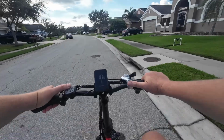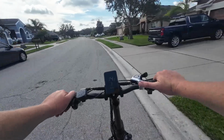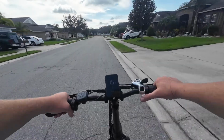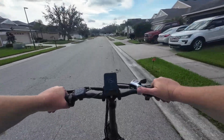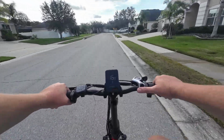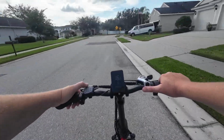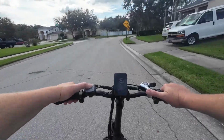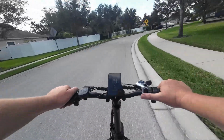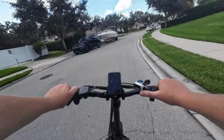Alright, so let's go ahead and demonstrate this. There's 4th gear. Pedal assist 3, I'm ghost pedaling. I'm going to put it in 5th gear. That eliminated the ghost pedaling. I'm at 15. There's 6th gear. Now I've got some pretty good resistance going, going at 16 miles per hour. I'm going to pop it up to pedal assist 4. Here we go. It's going to rock it off now. Now I'm ghost pedaling at 19. But I'm only in 6th gear.